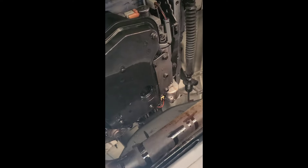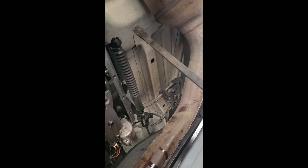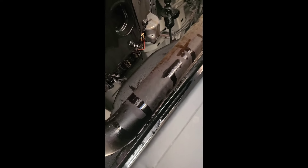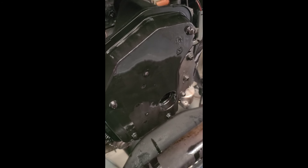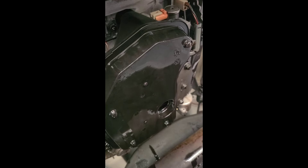Just to give someone in the future a cheat tip — I wasn't gonna mess with this whole exhaust, taking it off and dealing with the O2s and all that. So I grabbed my four-foot pry bar, put it right here on the crossover on the exhaust, pulled it down just enough to get the pan down. Quick cheat right there. Now I gotta pull this out, look in the pan, see how nasty it is, and see if it's worth changing both solenoids or if I need a whole transmission.